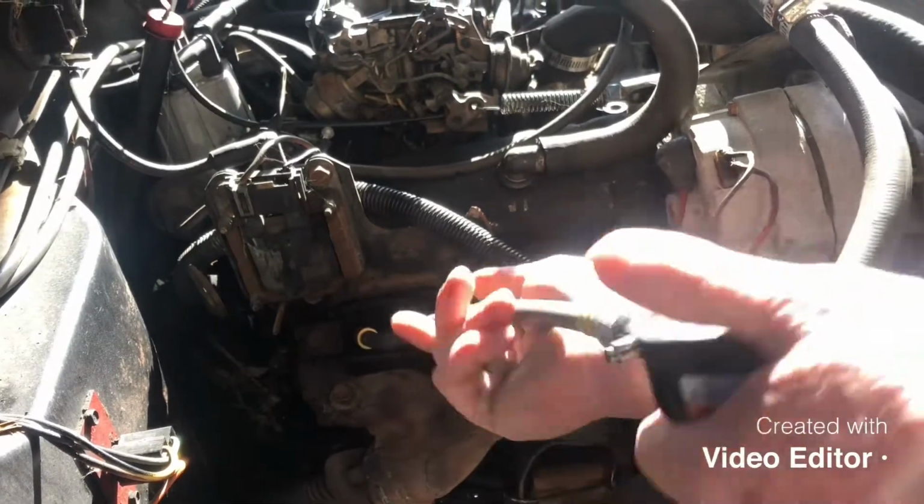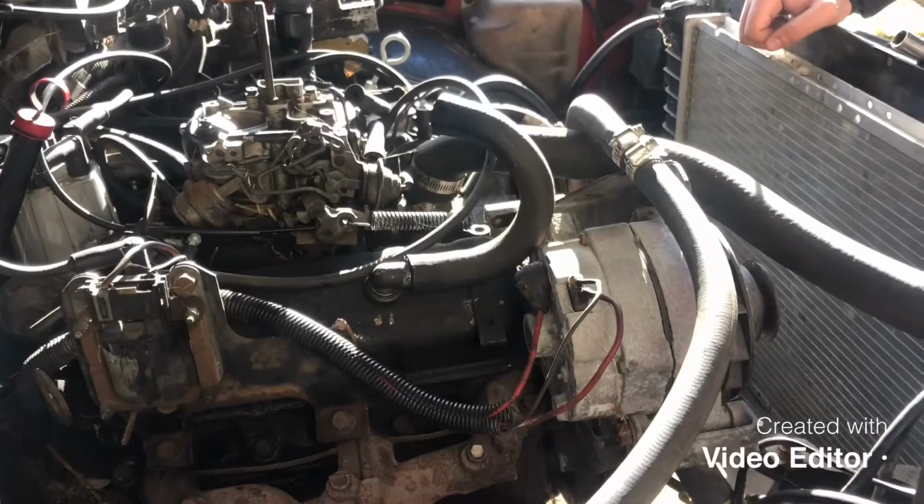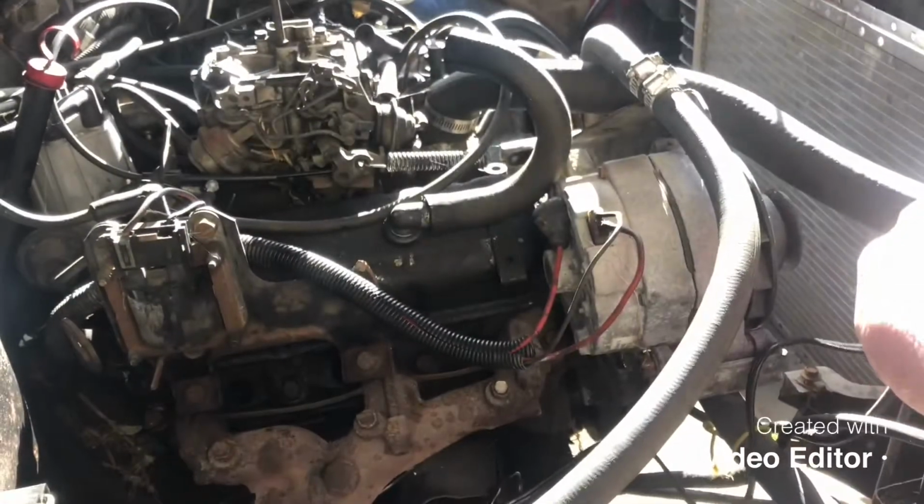We got one that's 110. The rest of them's 120 to 130. 110 is that number one cylinder. So I'm calling top end good. Well, I was gonna take the torque converter loose from the engine, let me turn it around, well crap, but yeah, this one's got some major stuff on there you gotta take loose.